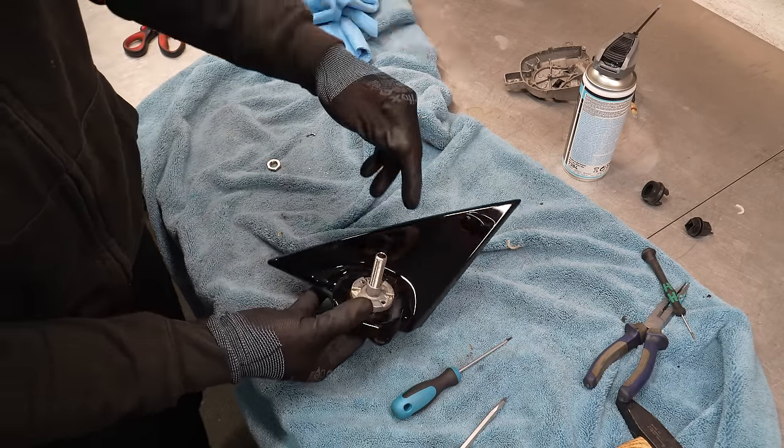Okay, that's good. I had to hit pause on the fuel pump because I ordered the wrong one. Turns out there are two versions, the US spec and the Euro spec one. The US spec has two connections here, which is what we have on the car. This car is US spec. I ordered the Euro spec, which only has one. So I simply replaced the cap. The rest of the pump is exactly the same.